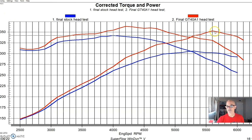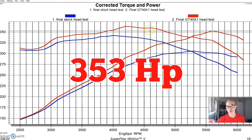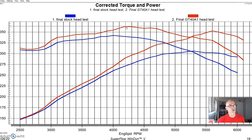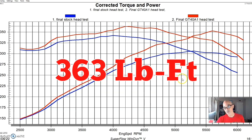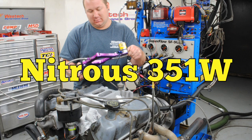We picked up power everywhere. This thing made 353 horsepower and peak torque was up to 363 foot-pounds. Even with a reasonable set of heads like a GT40 aluminum, it makes a little bit more than a set of GT40 iron heads from the wrecking yard. This gives you an idea that even this combination needed more cylinder head, and as we'll see when I do the test on all the cylinder heads, a good set of heads on this combination makes a lot more power than this.